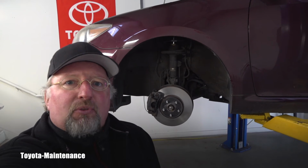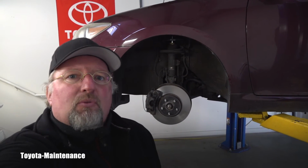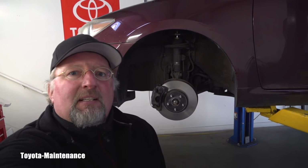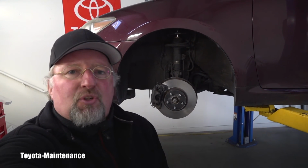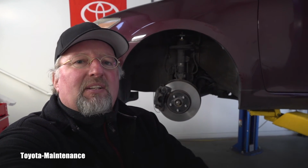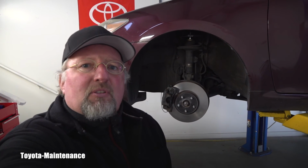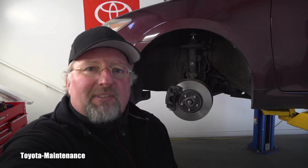But you don't need to wait until 1mm. It's common practice, right? If you go to the services, the technicians start recommending the replacement at around 3mm. Even the measuring gauge is in a red color. That means it should be replaced, right? So it starts at 3, 2, 1. I will never go below that because there is a potential the brakes will fail or you will start destroying the brake rotor.